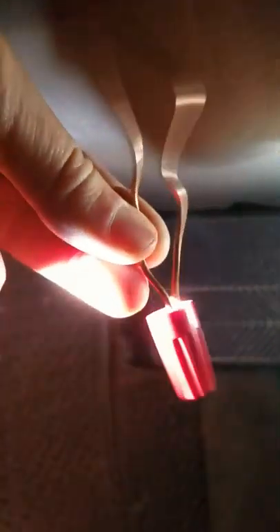Basically you follow the instructions on the service bulletin. I made this little tool here — just some copper wire threaded together for the final step — but you insert them in the correct spots, tap them together four or five times within eight seconds, turn the car off, and then when you turn it back on for the second time you plug them both back in. For the final step they have to be fused together — connected — you turn the car on with them plugged in and your track control light and your ABS lights are gonna blink like crazy really fast.